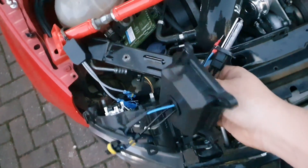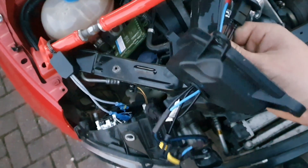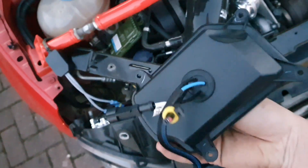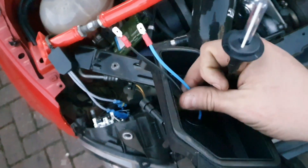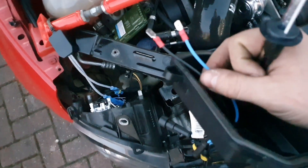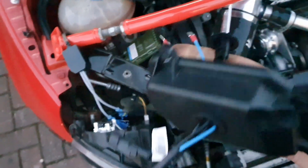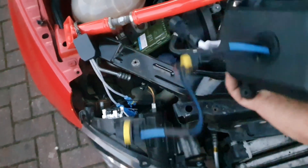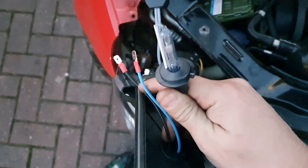We've got this through the rear of the housing now. You just want to make a hole big enough to fit the bung through. We've got the HID bulb and the wires. I'm going to test to make sure we've got this the right way around - there is a positive and a negative. Then we can relocate the ballast - you can see the green thing in the background.